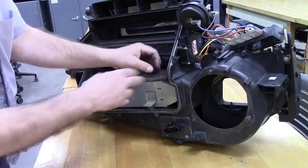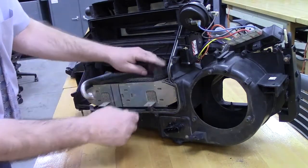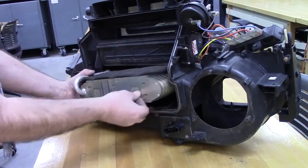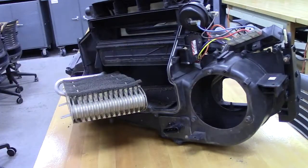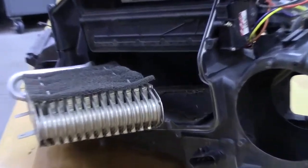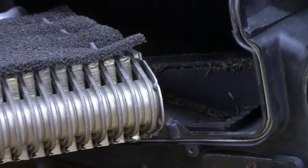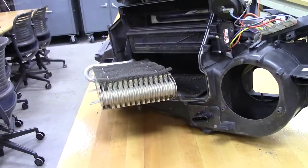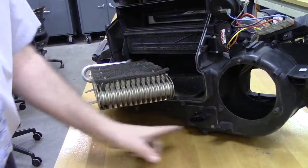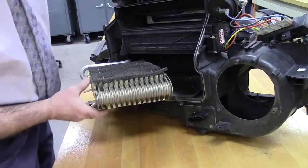The air conditioning unit has foam over top of it to catch any ice that may happen on this. Of course our air conditioning unit sits in here — on this one we can see the mice started making a nest inside of here and it's full of leaves and all kinds of debris. The air again comes in, up through the evaporator.